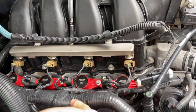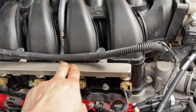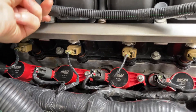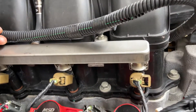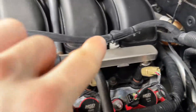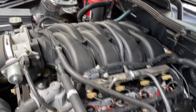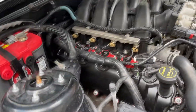We're going to start with the fuel injection rails because we can't get to the intake bolts just yet — the fuel injection rail has to come off first. You have a bolt where the rail is sitting, one where my index finger is, and one right there — two bolts on this side and two more on the opposite side. They're 8 millimeter, so you'll need an 8mm deep socket.